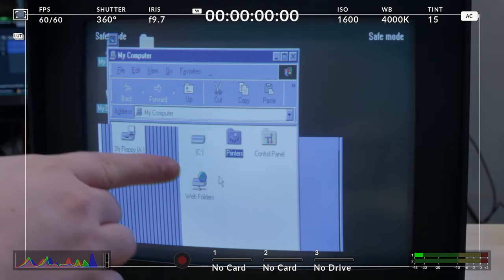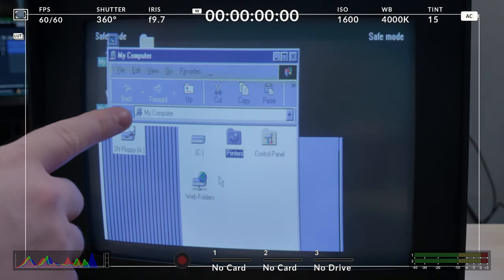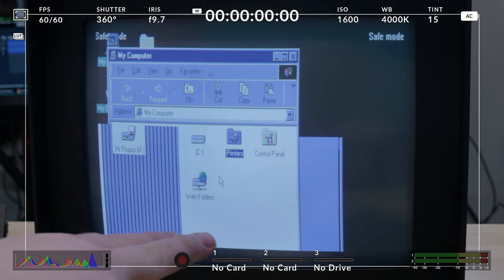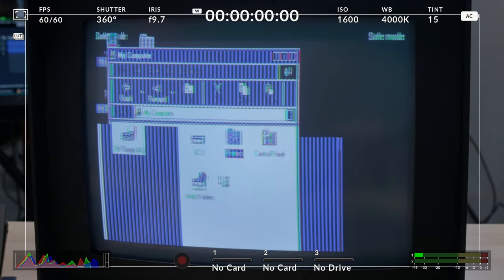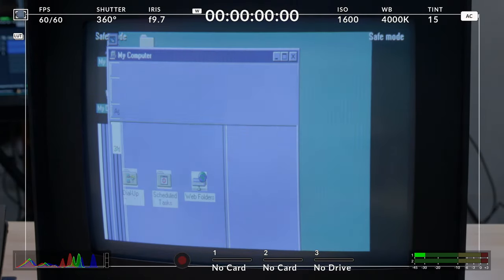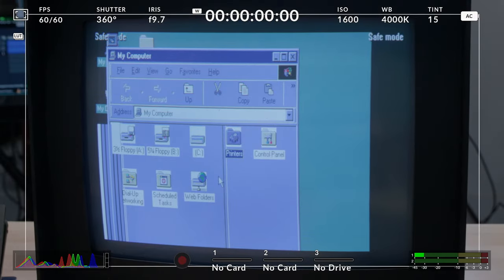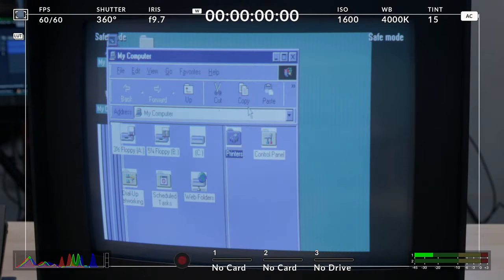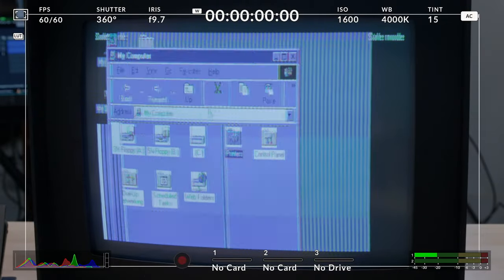But the other thing is that the colors are wrong, right? Because this shouldn't be blue. And I think that's the only one that's obviously wrong, but it definitely shouldn't be blue. And of course, there's also the fact that it's all corrupted, but I think the reason for that comes down to EGA being fed instructions for VGA. But you'll notice if I move the mouse, everything freaks out, but you can see that half the time it is as it should be.